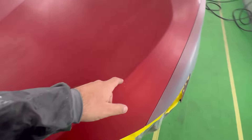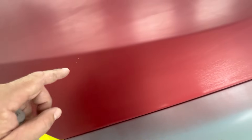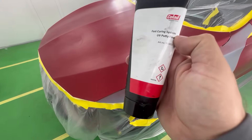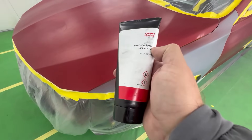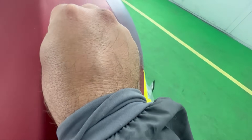There's a dent right here — we're not going to do body filler, primer, and extend it. We want our blend to be on this body line, but there are a couple of chips here. I'm not going to put paint right in them. I'm going to use my UV putty. If you're a fan of the channel you've seen me use this before — you really need to get this into your work procedure. We are not using 1k putties anymore; we're now using UV putties. The 1k putties shrink, take forever to sand, and time is money. All you need is a little bit on a razor blade and this stuff will fill it.